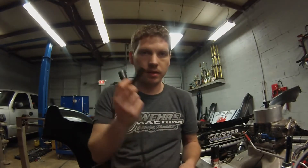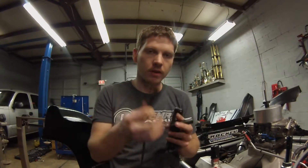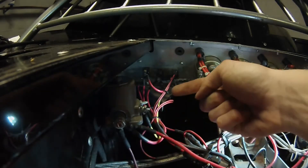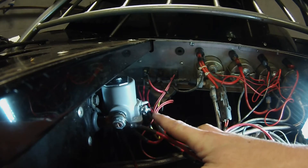First thing you'll need is a bump starter. What a bump starter does is it engages the starter without actually having to use the switch. You put one lead on the hot wire and one on your crossover. This is your power wire coming in, this is your hot wire, and the other side is your starter wire. This is your crossover wire right here — this is what goes to your starter switch.